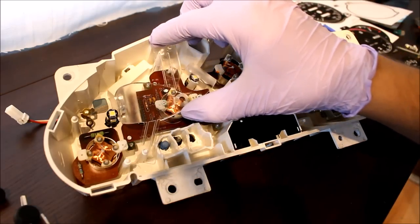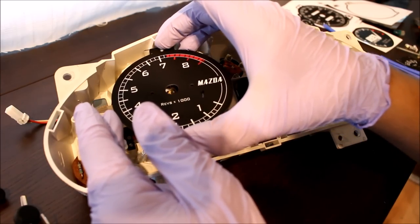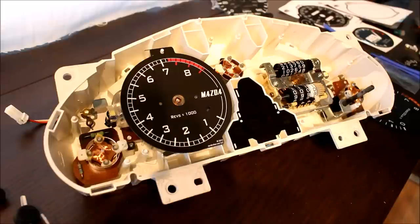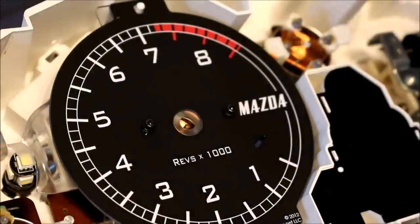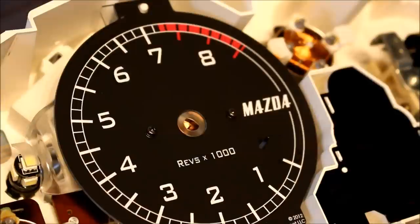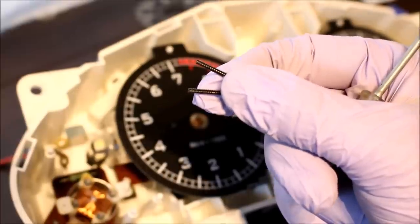Finally, get to put the new faces on. I've removed the old face from the little carrier, I'll put the carrier back on and then install my awesome new tachometer — it hangs by that little pin up there. No matter how you do it, just be really careful putting the screws back in because the faces are easy to scratch. They sit in there like that, and you don't need to make these very tight — just until they bottom out and a little snug. Repeat for the rest of the faces. Note that the speedometer takes the extra long screws; the rest are all the same.